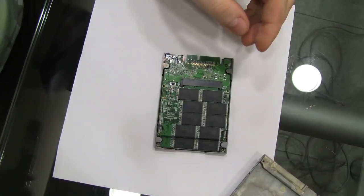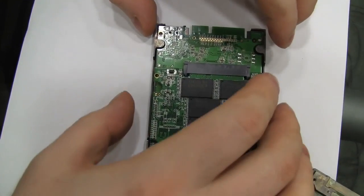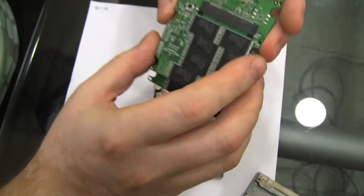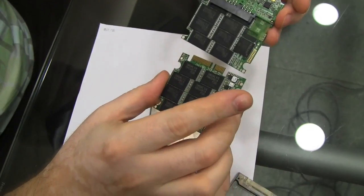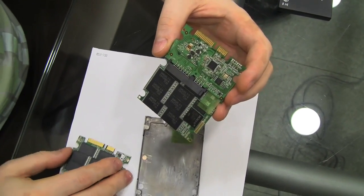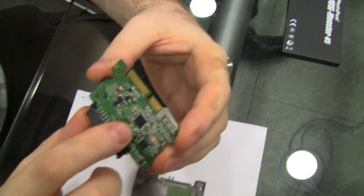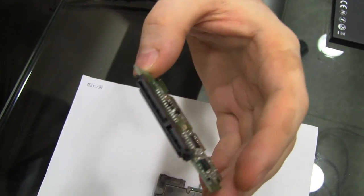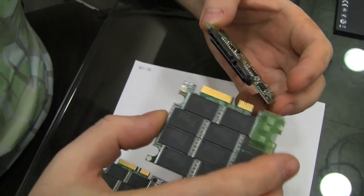What we got here — normally in your average SSD this is a single PCB inside — but what Photofast has done is they have fitted two SATA SSD modules, and you can take these apart. Both are 128 gigabytes with their own 64 megabyte of cache memory. The cool thing is this little extra card, as it has a Jmicron RAID controller on it, allowing you to connect the two drives together and run them in a RAID configuration for extra performance or for data security.